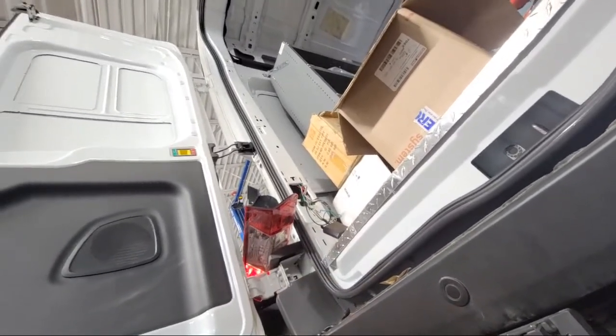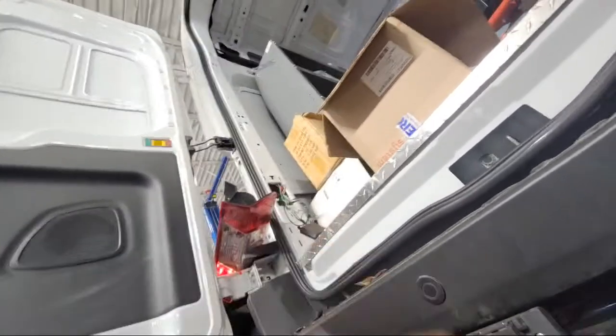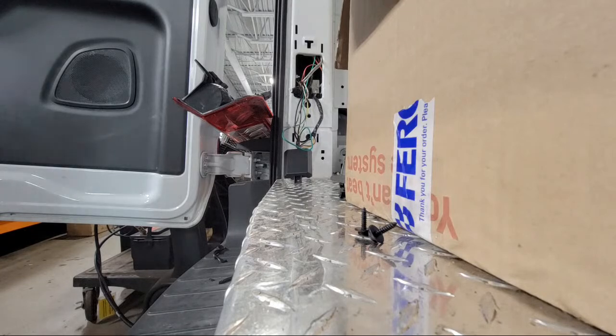I'll be right back. I'll put the turn signals on or the flashers on, and let's see if that circuitry is good. But either way, we got power going from that light into the module, letting that module know to turn on the power circuit for the trailer, but it's not doing it. It's a bad module. Okay. Well, I'm continuing to check and I'm live right now, just so you know.